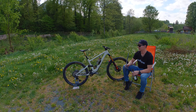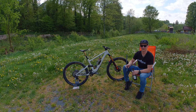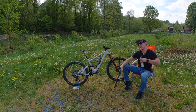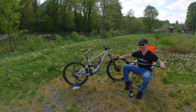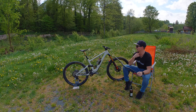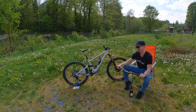The cockpit is provided by Joystick — it's a 35mm bar and stem, with a 35 millimeter stem. The bar is a carbon one with a degree back sweep and I'm only running 760 millimeters of bar width, which is pretty narrow. But I tried it — it's way easier to navigate through trees and put the bike into corners. The best analogy is like push-ups: the further out your hands are, the more pressure it takes to move the body. So you bring the hands in to save energy. There are a lot of benefits to riding narrower bars and I don't feel any need for 800mm.